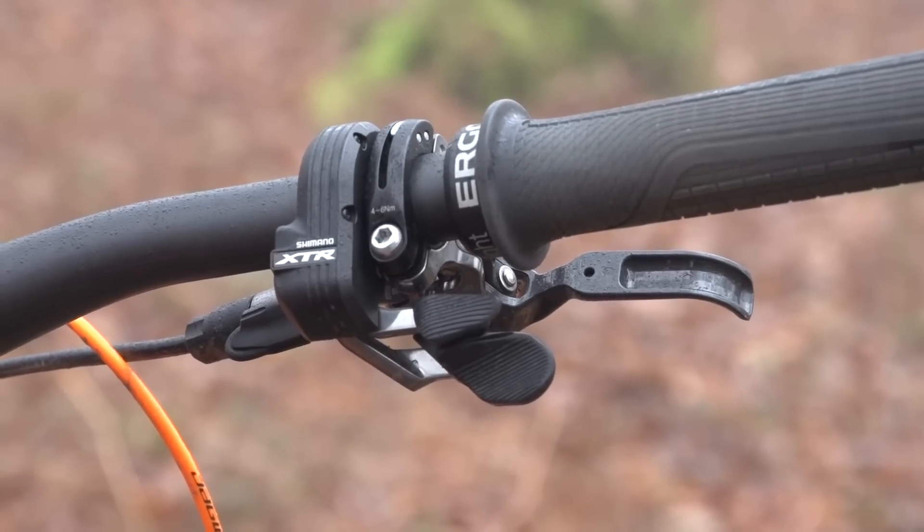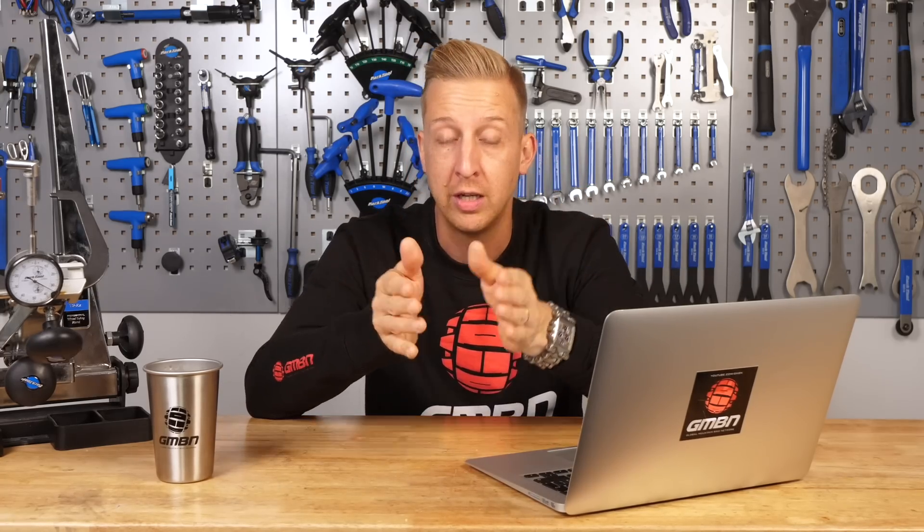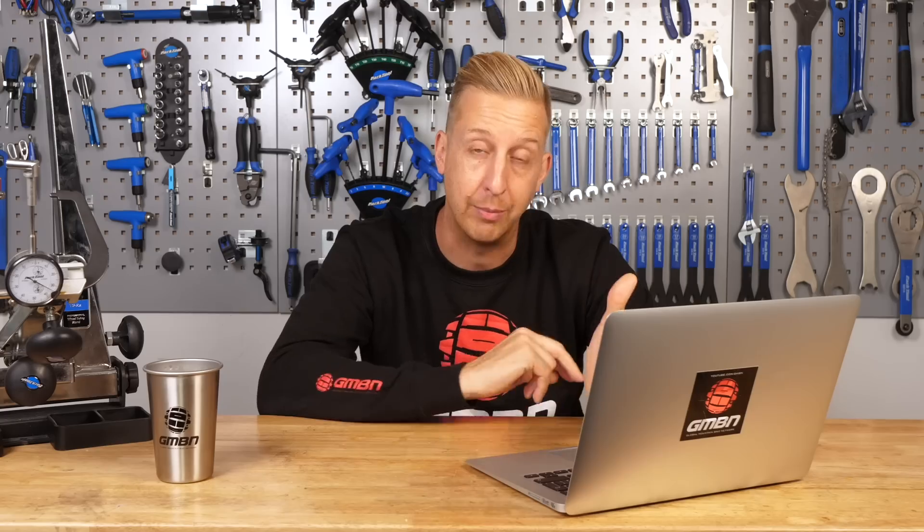With your front derailleur: on a three-by, you can often use it on a two-by. You basically set your limit screws, then get a compatible two-by shifter instead of your three-by shifter. Some three-by shifters have a little switch to convert them into a two-by, but that's not on all shifters, so more than likely you'll need a two-by shifter. Using the three-by front derailleur on a two-by may work adequately, but it might not work as well as a dedicated one — the cage profile was designed to shift a whole other chainring, and without it, there's a recess where the chain could slip down and derail. I do think it works though, and I'm pretty sure I've done that in the past.